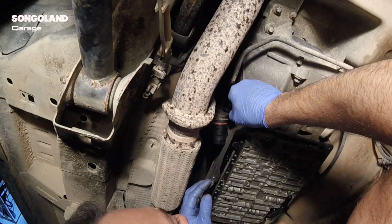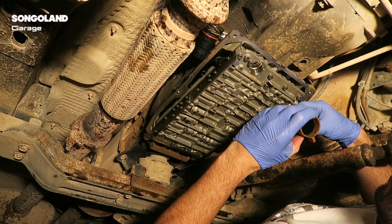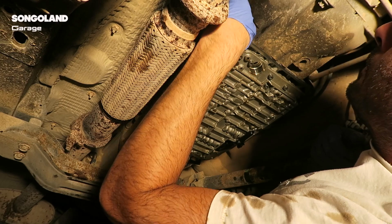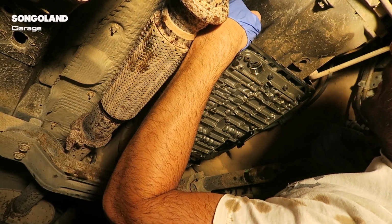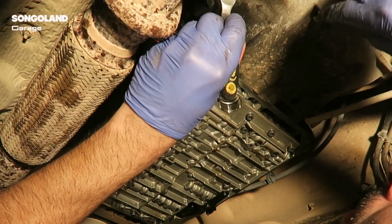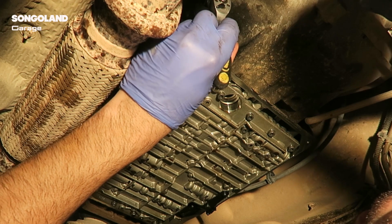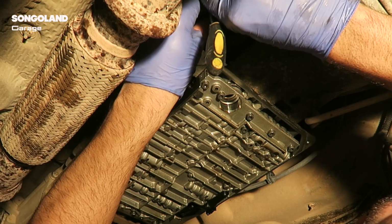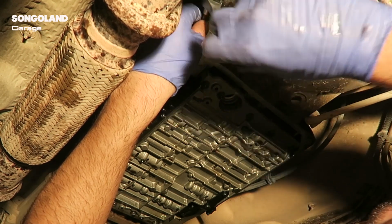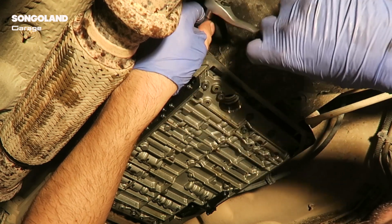As you see, it has some rubber rings. We are going to replace that. At the end I don't put the new connector, because after looking at my original Mercedes connector I think it's better quality and it looks in really nice state. Then I just replace the seal rubbers from the new one to that one and I put it back in place. Be careful at the time to tighten this screw because we don't want to damage the board where this connector is attached.